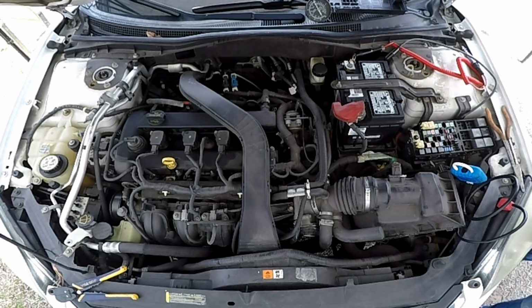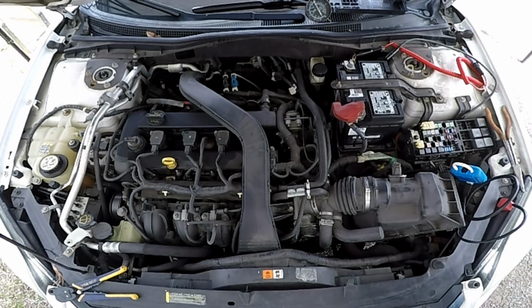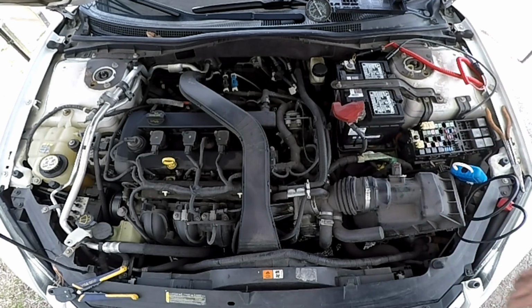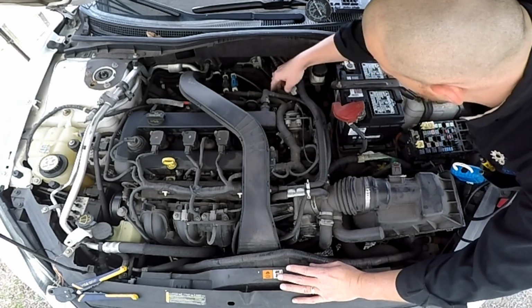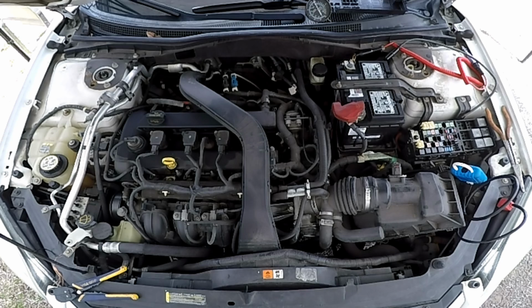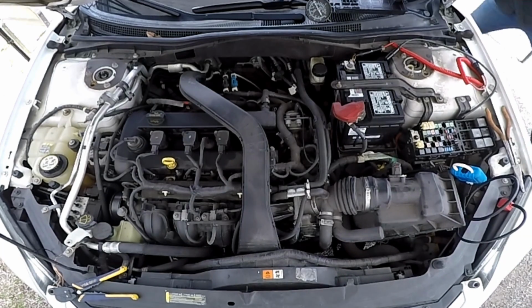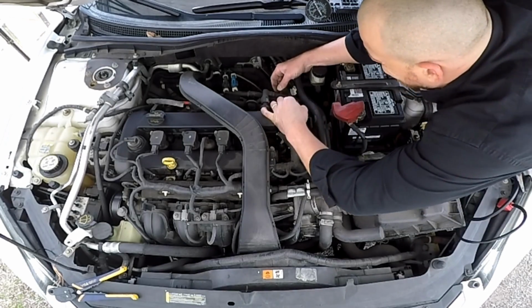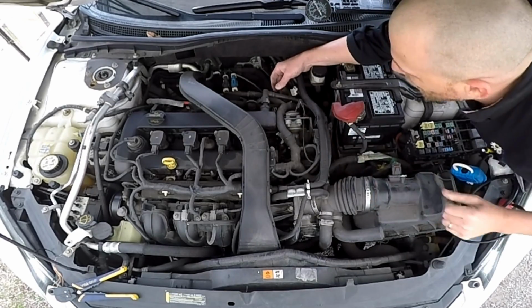Now at this point, if I want to do this with the car off, I would want to manually energize the relay, manually energize the solenoid. I would need a vacuum supply there too. So let's try this again, with the car running, and then I'll figure out a way to teach you guys how to do it if you did not have a system like I'm dealing with right now, where it's cold enough that you can use the car to do these checks. No airflow at all.